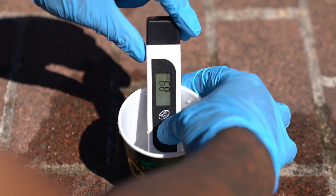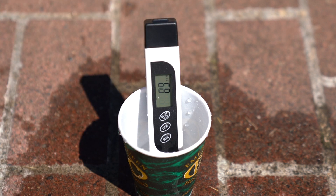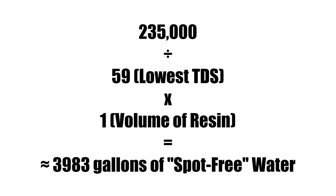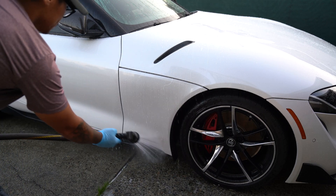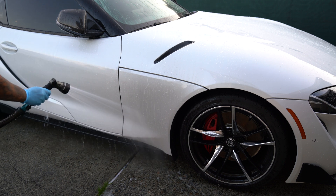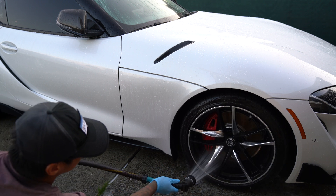The CR Spotless page lists a few different cities' TDS values: San Diego had 400 ppm, a city in Orange County had 40 ppm, and Grand Rapids, Michigan had 170 ppm. TDS ranges quite a bit around the world, but luckily I had a pretty good start, especially considering the DI Pro is rated based on incoming water of 110 ppm TDS. Running the formula, 235,000 divided by my lowest TDS of 59 gives roughly 3,983 gallons — very close to the manufacturer's listed 4,000 gallons. At the highest TDS of 91, I'd get about 2,582 gallons. Considering I only use this system for a final rinse, at my rough estimate of 20 gallons per week, I'll get about 2.5 to 4 years of use.